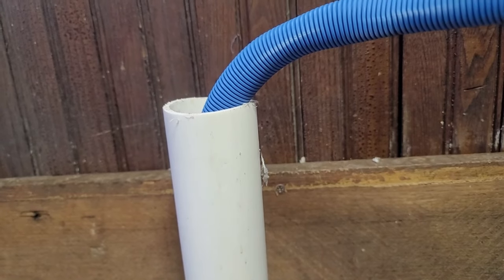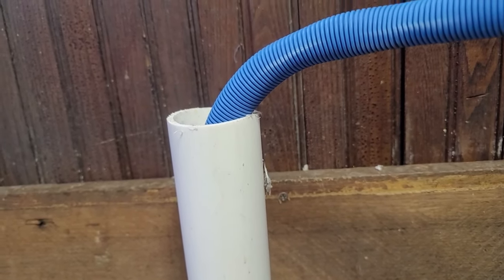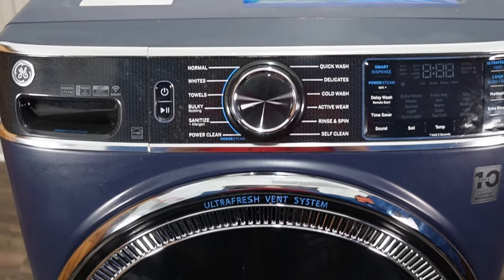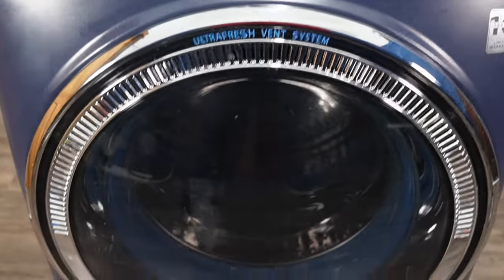Additionally, make sure that your water drain hose does not have any kinks or binds in it or damage. I've seen a few situations where the hose was pinched, causing water to not drain well, even though everything else was seemingly fine. Once you have everything taken care of with the drain hose, let's look at the washer pump